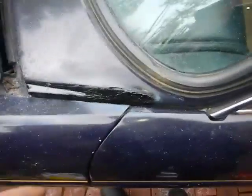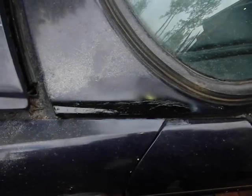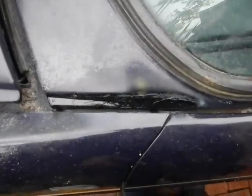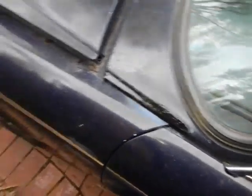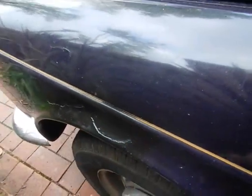This is all sealed for now. Put the seam sealer across that just to fill the little holes and paint it over. I didn't even sand it as you can see, just went with my finger, let it set and then went psh. Put my hand there so nothing went on the windscreen. It's a half-ass job I'm doing, but there's no point spending real time doing all this stuff, like filling that and making it look nice. No point.